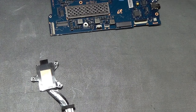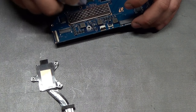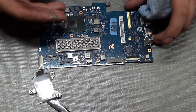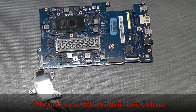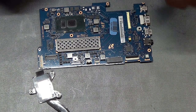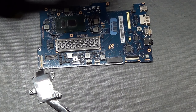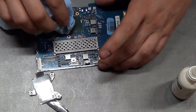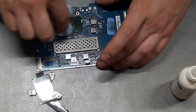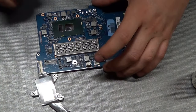If you have a laptop or any kind of computer, keep in mind that the thermal paste it came with, especially if it's a couple of years old — once the computer goes through the heating and cooling cycles, CPUs get up to around 120 degrees Celsius. You will find on all computers, once you remove the heatsink from the GPU, that the thermal paste is completely solid. They solidify after a while and no longer conduct heat as well. You want to give it a couple of passes with the purifier — it actually just removes any oils and contaminants. It does smell kind of like a mix of acetone and rubbing alcohol.